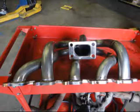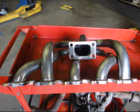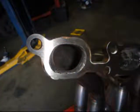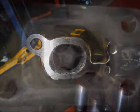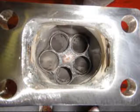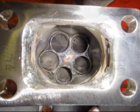The RSI 850 Turbo header drops the weight by over 33% compared to stock. The header meets perfectly to the stock 850 head with a top-mounted T3 turbo flange. Custom turbo inlets and outlets, as well as oil lines and a downpipe, will be needed to complete the project.